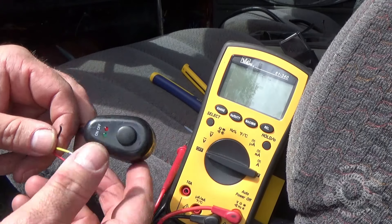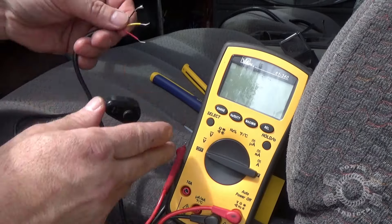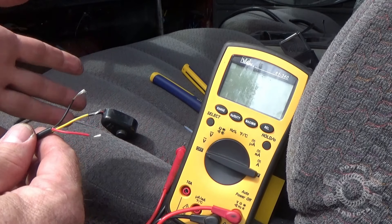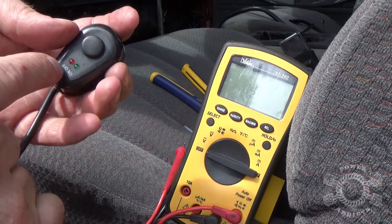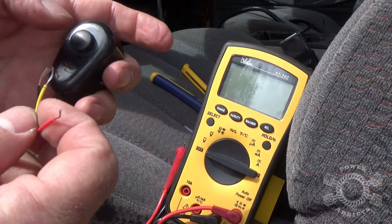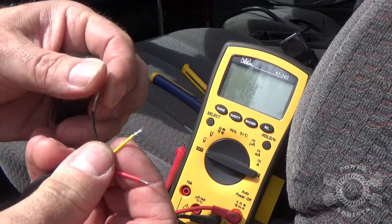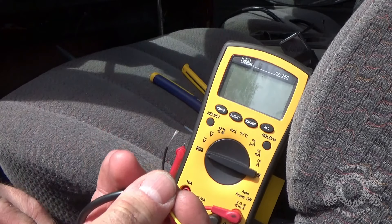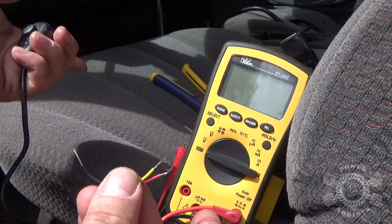After running my backup camera wire, I've got this cheap little surface-mount push-button switch — it came with those wiring harnesses for your LED light bars. It's got a little sticky pad so I'll stick it where I want it. We've got three wires. The switch itself only needs to complete a circuit, so you only need two wires to complete the circuit. For your LEDs to work you need the ground — black is going to be the ground. So we only need these two wires right here. But if you didn't know that, how would you figure it out?